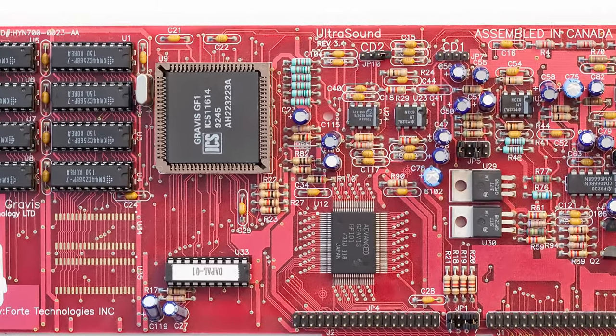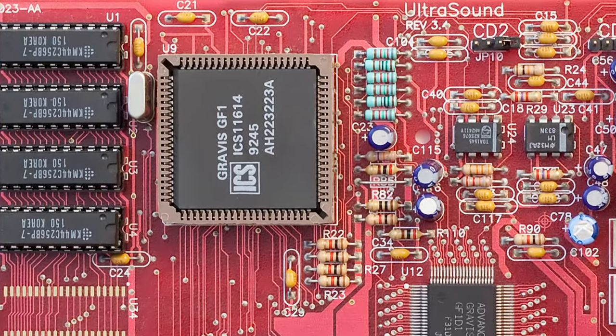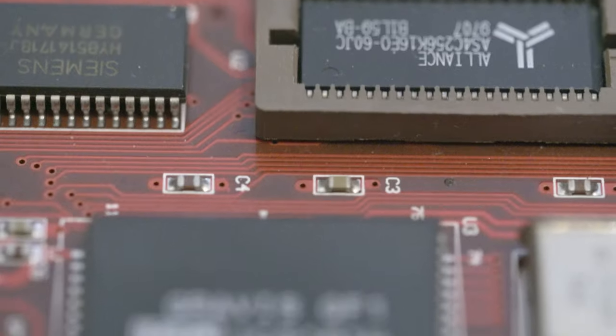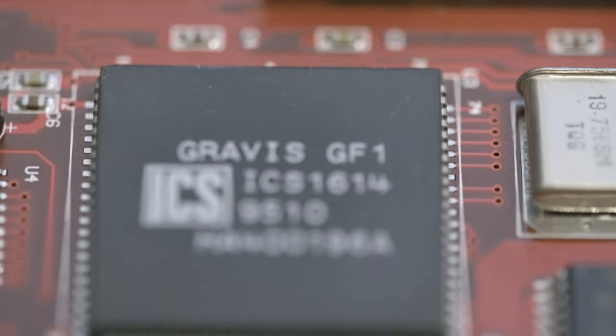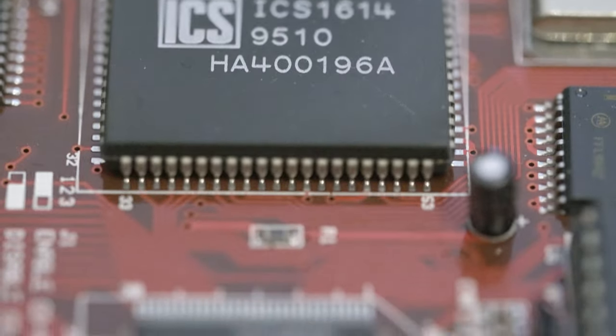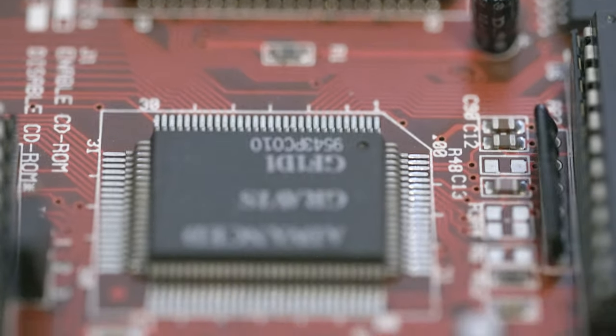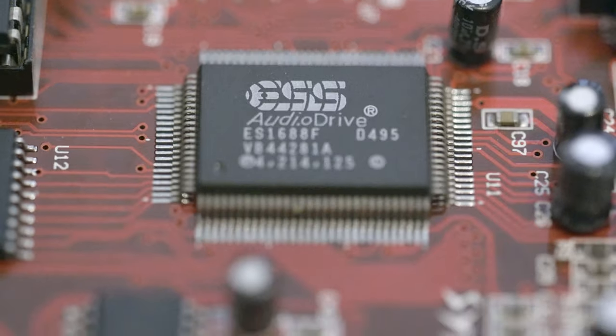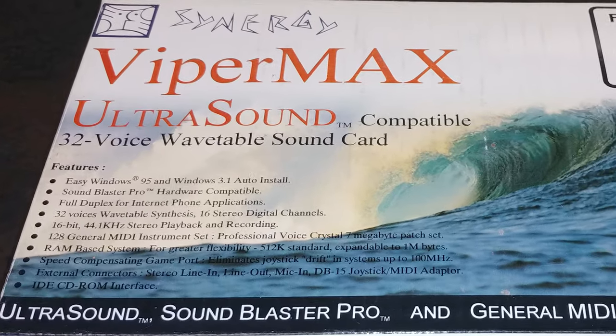Classic was one of the first sound cards that was able to play sounds in 16-bit 44 kHz, and since Extreme uses the same chip, it's able to play sounds in the same resolution. However, Extreme came out 4 years after the Classic, so it's nothing special anymore, and of course the ES1688 can do the same. GF1's got one little drawback when playing sound effects though.